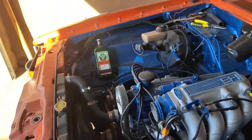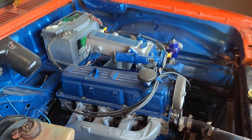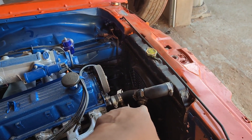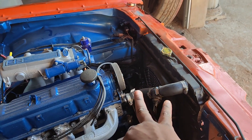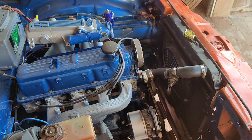I'm going to test it now, but the car is cold and doesn't actually start. So I'm going to mimic what the temperature switch does — which is to bridge the two wires together — and I'll use my pliers to join them together to check if the fan is working.